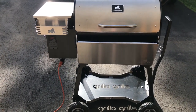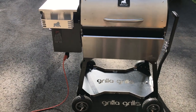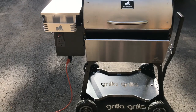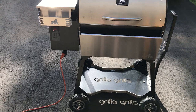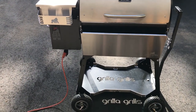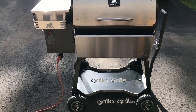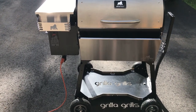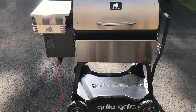This doesn't happen every time, but it can happen. When you try to restart your grill with a pot that has residual fuel, the airflow is restricted, so it cannot breathe properly. It's like throwing a huge pile of leaves on a fire — it will smoke like crazy. Smoke has gases in it. Once the pellets do ignite, all of these gases will ignite, just like leaving the gas on your grill too long with the lid shut. As the gas builds and the electric igniter does ignite, you can get a small explosion. Opening a lid on any grill — propane, pellet, or otherwise — during startup is good and safe practice.